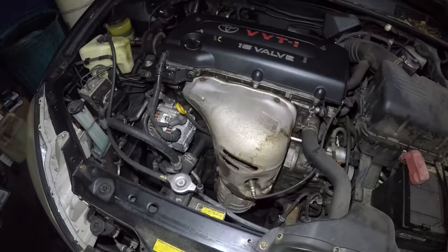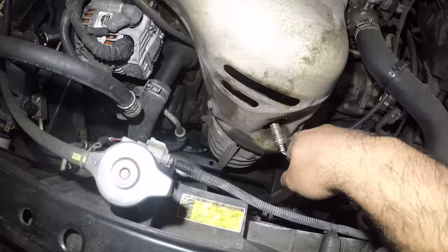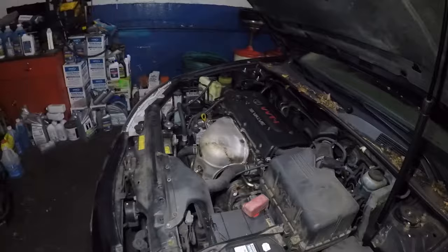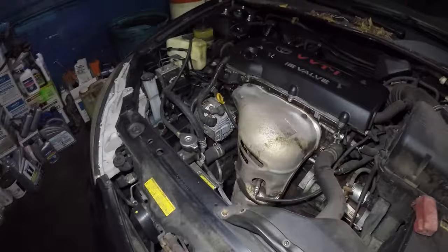Here's the oxygen sensor. You don't have to remove the whole catalytic converter — all you need to do is remove this sensor right here. You can use a cleaner; they sell cleaner for this. I'm going to show you the cleaner I'll be using. We're going to remove that sensor while it's on the car — all you're going to do is spray a little bit in there and also spray the sensor down.